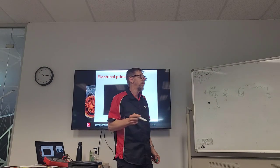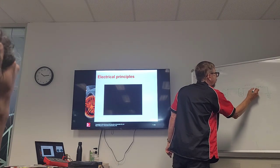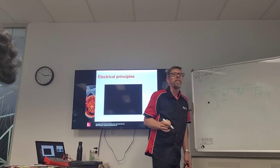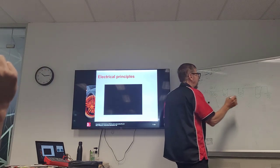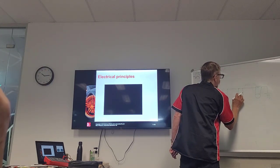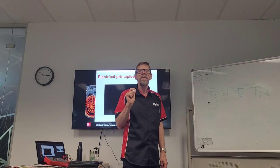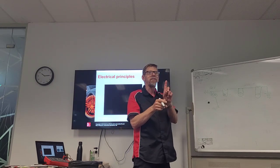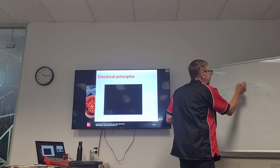Okay. And then he closed the switch. Oh, so he did here too. He did here. What was that one? Zero. Exactly. So that was zero. But then he closed the switch. What did that go to when he closed the switch? Zero. Why is it going to zero? Because it's closed. But why? What makes a difference? Because it's just a straight line. Because now we've got 12 volts on both sides.